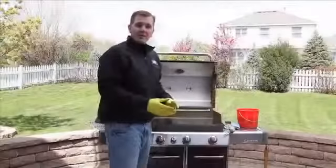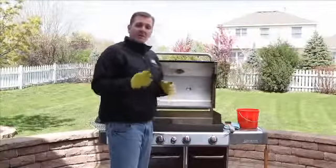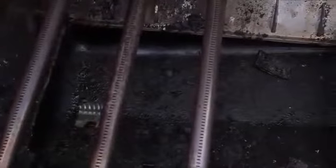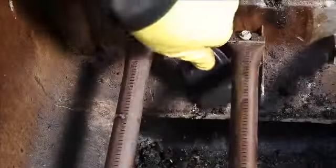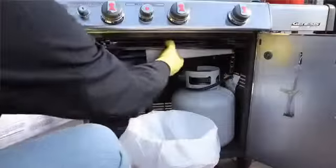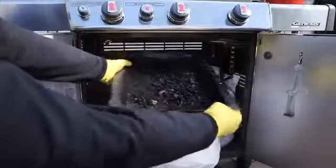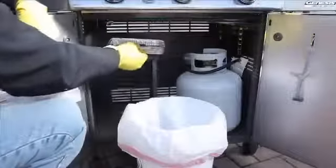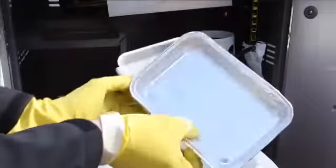We've shown you how to clean your burner tubes. Now we're going to focus on the rest of the inside of our grill. If you have heat deflectors inside, follow the same procedure as cleaning your flavorizer bars. Look inside the cook box for any big pockets of grease accumulation or food particles. Use a putty knife or flat straight edge to scrape the excess grease into the bottom tray from inside the cook box. Remove the bottom tray from under your grill and place it carefully in a trash can. Scrape the inside of the tray with a putty knife, then clean with warm soapy water and a fine steel wool pad. Remove and dispose of the dirty aluminum drip pan. Wash the catch pan with warm soapy water and rinse, then replace the drip pan with a new one.